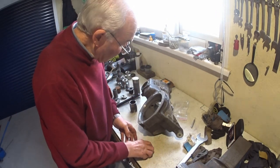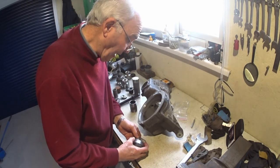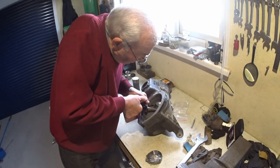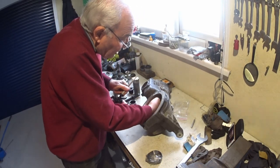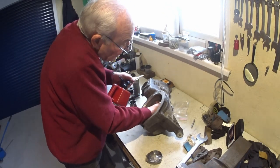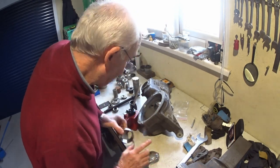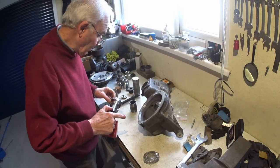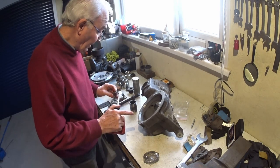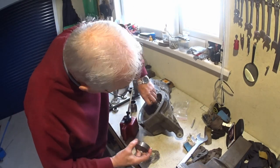Okay, so I've warmed the case, I've cleaned the area up very lightly and not removed any material from where the outer race is going to sit for the inner or bottom pinion bearing. I'm just putting a light touch of oil on the surface, same with the outer race, just a bit of jungle juice to encourage it, and don't forget the shim. So shim's going in,